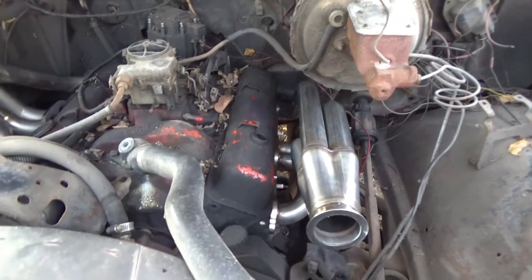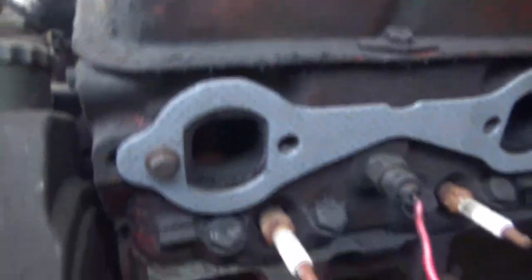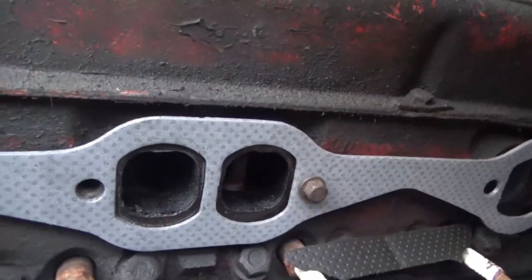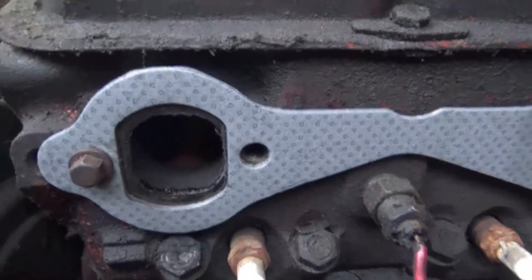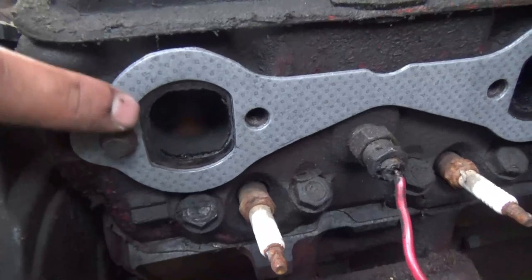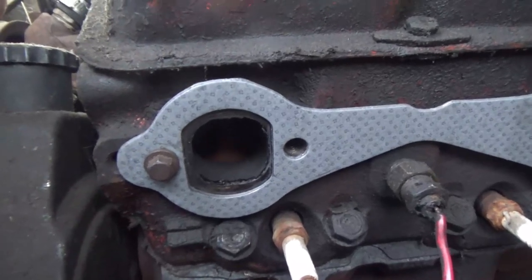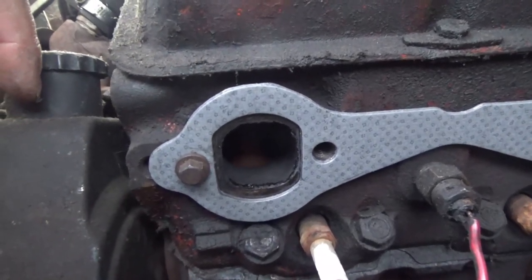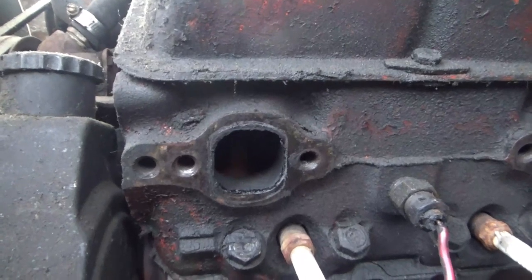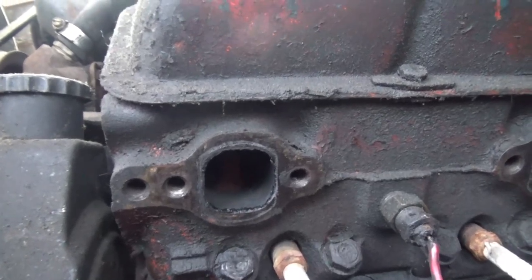That's about all I have to say about how they fit. Let's compare how the ports match up - as far as how they match up to a set of stock 305 heads. You're just going to have to kind of use your imagination judging by how much the flat part is versus how much you see on there. I already kind of looked at it before, and I'm pretty sure this is good. The gray line kind of shows you where the hole's going to be, and nowhere around the circle does it overlap.